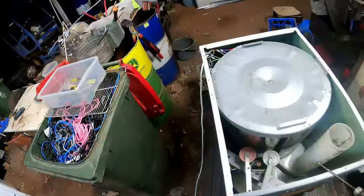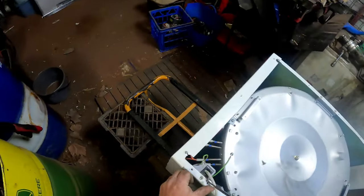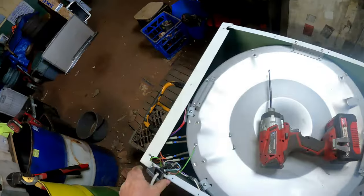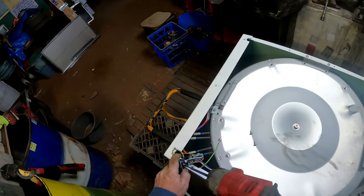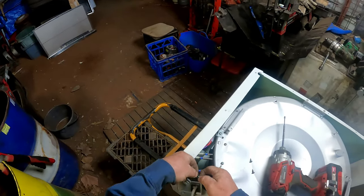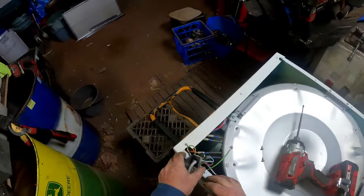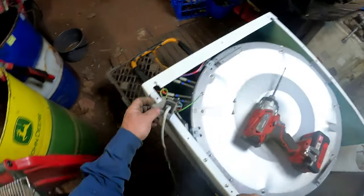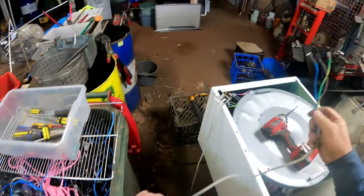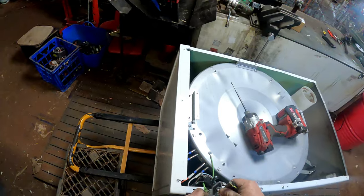We've got to get the cord out too, so we'll do that at the same time. I think it's this screw here. Both screws actually. We'll just sit those screws there. We might do the cord first. I reckon that's feasible. It's quite simple to replace the cord when you're doing a lot of scrapping. So simple these are. It's only push-on connections. You just got to make sure you're putting the right one on the right section. So we can put the new cord through first, so we know where we're going to be. Makes it a lot easier. That way you don't get your wires the wrong way, like your active and your neutral.